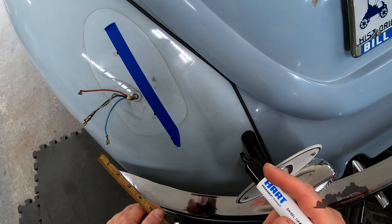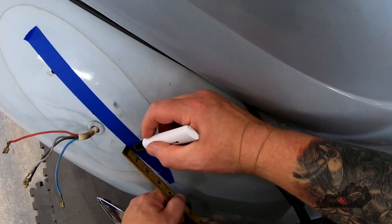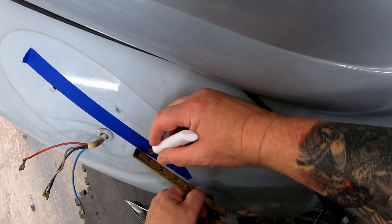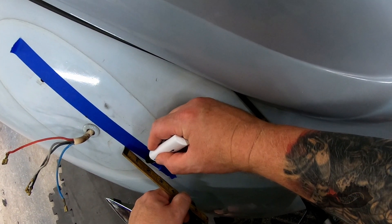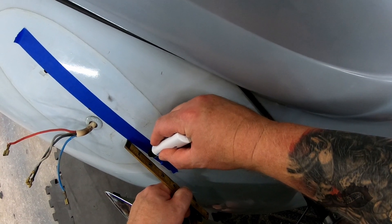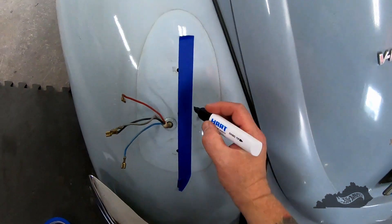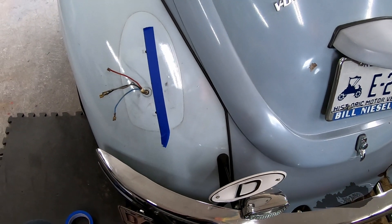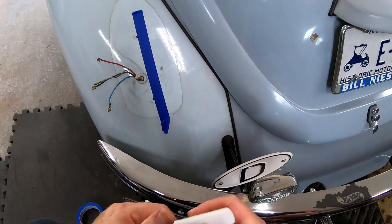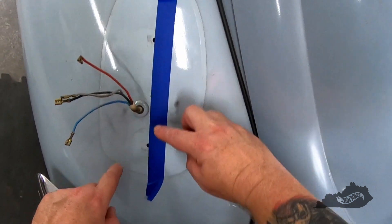Don't worry about the outline left from the seal of the 68 tail lights — I'll remove it with some glass cleaner a little later. The housing for the 68 tail light was removed by removing the two 5/16-inch nuts from inside the fender. I'll use painter's tape to mask a line from the center of the top mounting hole past the center of the bottom mounting hole. I'll measure three inches down from the original top mounting hole and one and a half inches down from the original bottom mounting hole — these will be the locations for the new mounting holes for the 67 tail lights. Check, check, and double-check your measurements before drilling the new holes.